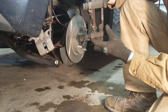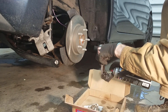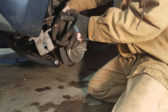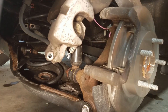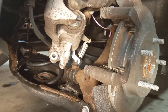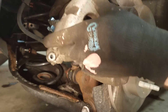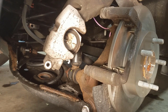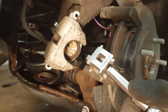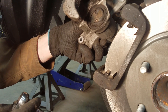This goes on next — I'm going to clean all the gunk out of here. Now, from using your brake, this piston is going to get pushed out, so you have to push it back in. But because you have an emergency brake that's cable actuated, there's a screw mechanism, so you essentially have to screw this back in. That's where the brake cube comes in. Look at the tool and find a set of pins that match yours and tighten it up. The rubber got all warped, so I'm going to go a little past where I need it and then reverse it just a hair.